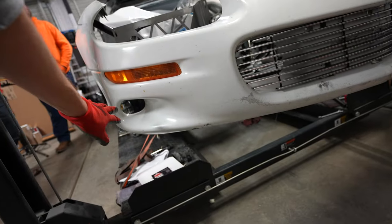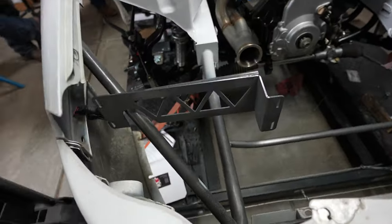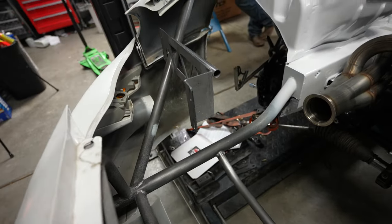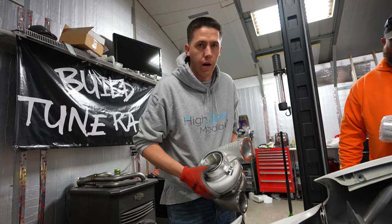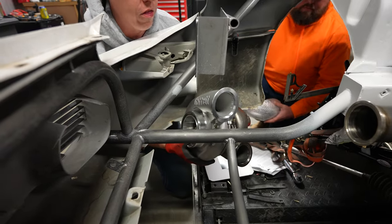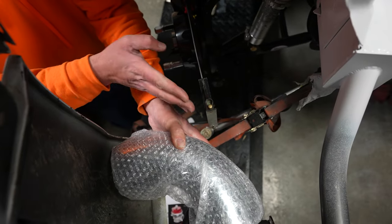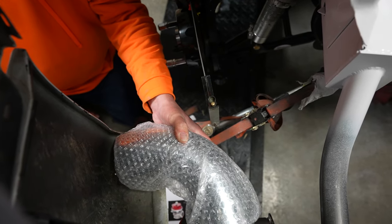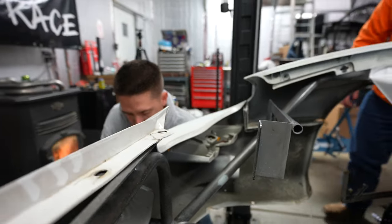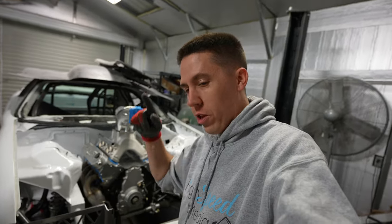We put a stand-in representing about where the wheel is going to be. I was thinking maybe somewhere in here — it'd be real close to hitting. We might be able to shorten up the 90 to get the exhaust exit a little shorter and come right out the fender, but it's going to be close. We're just trying to get a visualization of what may be possible. Either way we're going to make it work, but we lost a whole lot of room really fast — even with the tube front end.